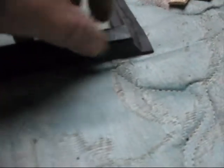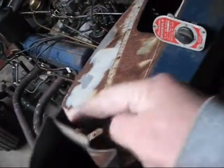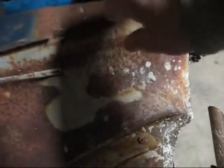See, this little track down here is the part that goes into the metal on the old windshield frame, and I may have to remake some of that windshield frame. I was thinking about Resto Dan. I was watching him remake the track that the rubber goes in the trunk on his 63 Impala on video a while ago. This might be kind of like that, because part of this is destroyed and welded, and I'm about to cut this weld loose and save what I can of this track and maybe recreate some of it. But once I can slide that windshield into place, I can come out here and build my center post. I think it will all kind of fit together.